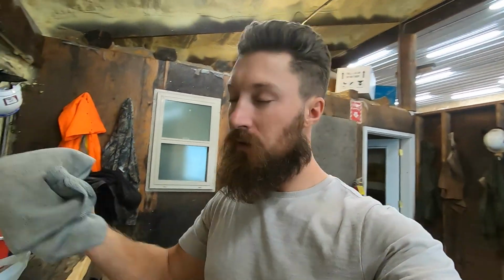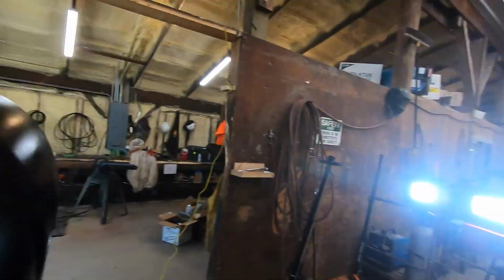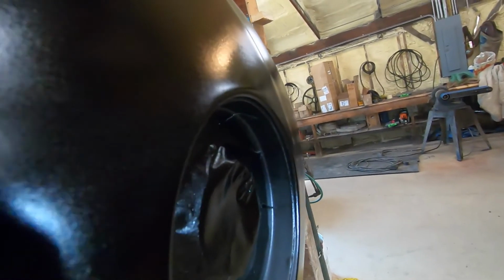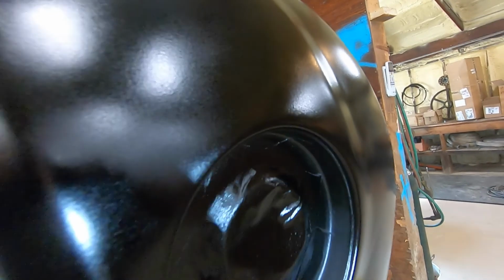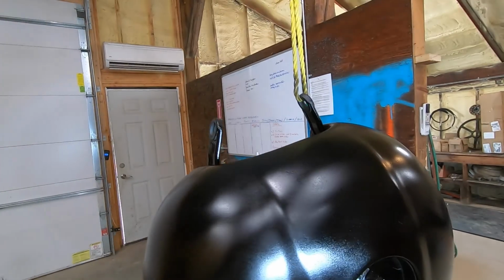Okay, remember I made some comment about tack cloths and not fully understanding why they're necessary. Well, there's no dust in here, right? So I thought surely it seems like overkill. I don't know if it's going to pick it up. Maybe there's a little hair right there. I don't know if you can see that, but that clears that issue up in my mind, and hopefully yours too. Doesn't matter how careful you try to be or how controlled your environment, it is worth tacking it between coats.